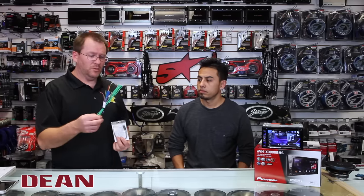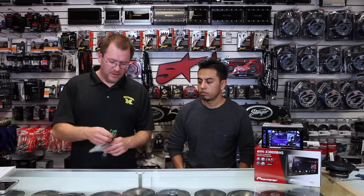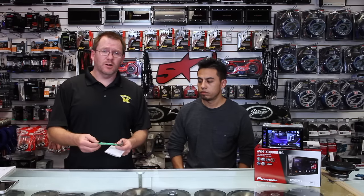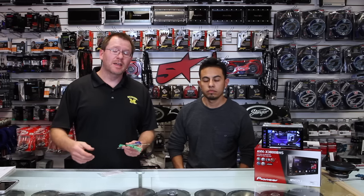There are a couple different ways that you can hook up your new Pioneer radio plug to get the menu system to come active. Things like Bluetooth and restore settings and other things aren't going to function if you don't hook up the parking brake wire. A lot of you just go, 'I grounded it and it doesn't work.' Yes, because that's not how the Pioneer works. The Pioneer needs to see a pulse where it's on, off, on. And to make things even more exciting, it's actually a timed pulse — it has to see on, off, on with a delay.